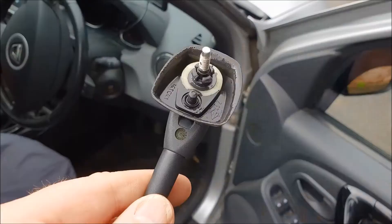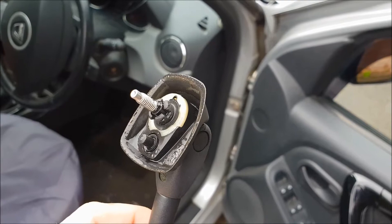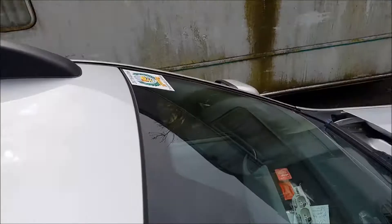Lights all undone. Right, there's the area of concern. As you can see there's a washer behind that, so I'm just going to unscrew the aerial socket, have a look at the washer, and get it resealed. The great thing is it doesn't look to be any corrosion in there, so that's good. It looks to be an 8mm socket — luckily I've got a deep one because you need it deep to get up in there. I've removed the antenna from the top of the car. I'm going to put some clear sealant around that thread. There's the hole that's left, so I'll give that a clean up and put a bit of sealant around that. I'm pleased there isn't any signs of corrosion coming through there.